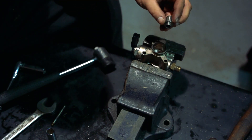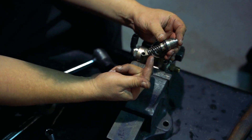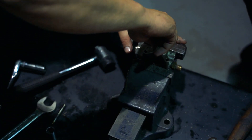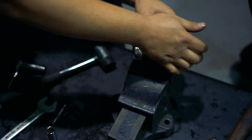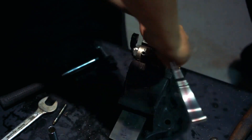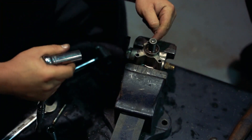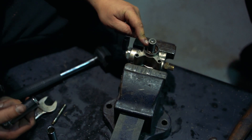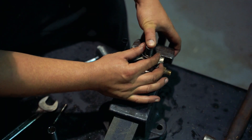Now, as I said about the sleeve — little side in, big side up on this piece. Slide that into there. Use a new seal, with the spring pre-done, then put that in there. You would use a socket — get an 18mm socket and push down when you do it. There's no torque setting we can find anywhere, so I would say do it firm-tight without overdoing it. Know your limits. Give it a tap on the ratchet with a hammer. That's nice and smooth in there.